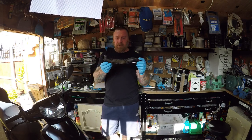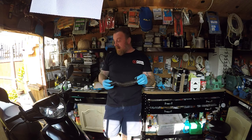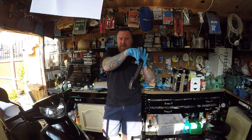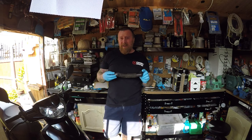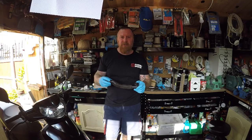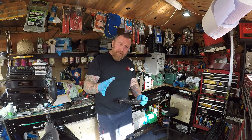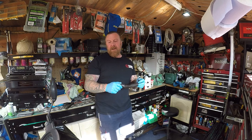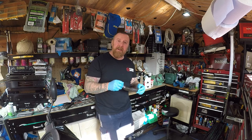I'm going to put this back on and tune it. There's a little hole up top — it does go in. That will get some nice fresh air. I pulled this off and was worried about rainwater getting in, but no — we know the Speedfights don't do that either and they run really well without this link pipe, except the white one I had which had to have it. This is what I try to say — a one size doesn't fit all. My videos are there to help you. The claw hammer works 99% of the time. Use an impact driver if you can't do that. Taking the washer out works on Speedfights but certainly doesn't help on an Aerox.